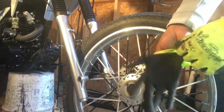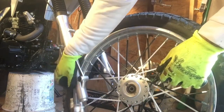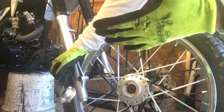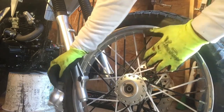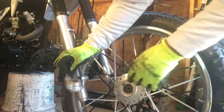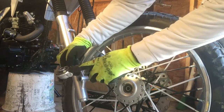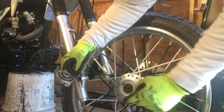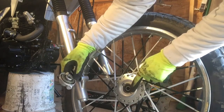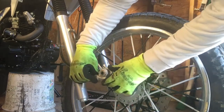What's up, this is Freak Guy. I'm just gonna do a quick video for a guy who's having problems putting his front wheel on the TBR7 250 dual sport. I'm gonna show him how the speedometer — right here it's got two little tongues on it, one on each side. Those two tongues you're gonna line up right in those two slots here and here, and it'll seat right in there. Before I do that I'm gonna put some grease on it.